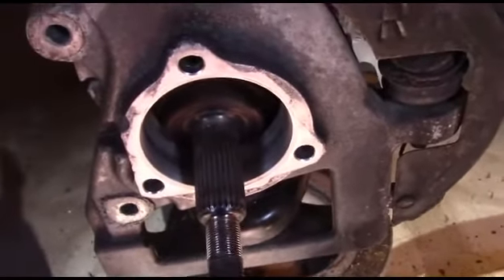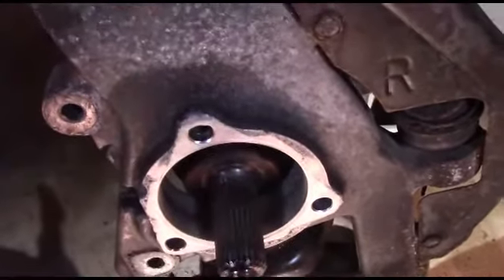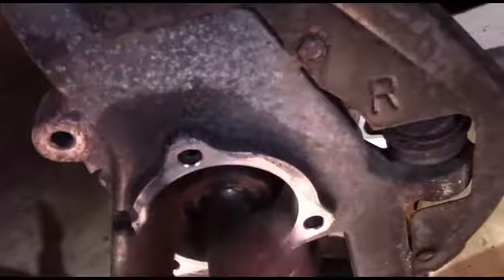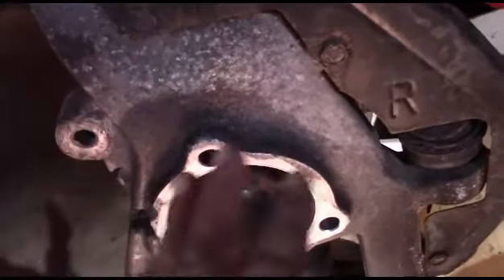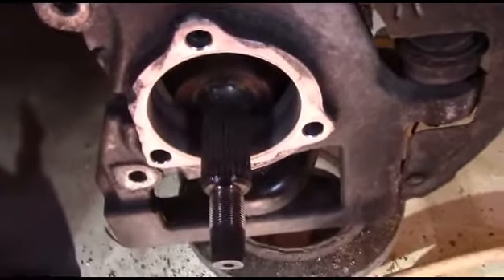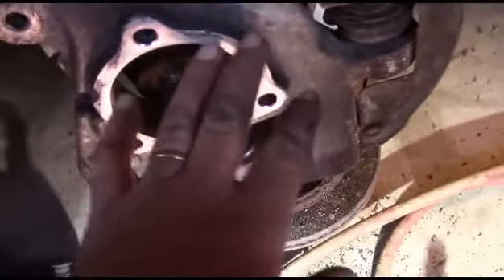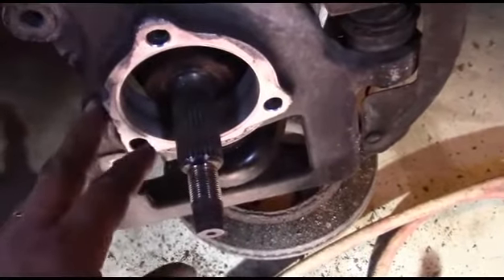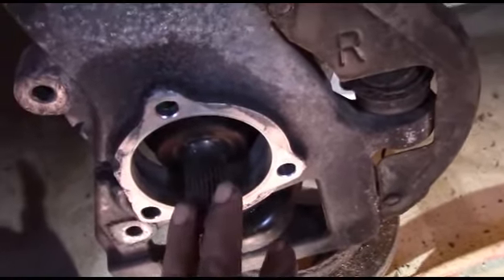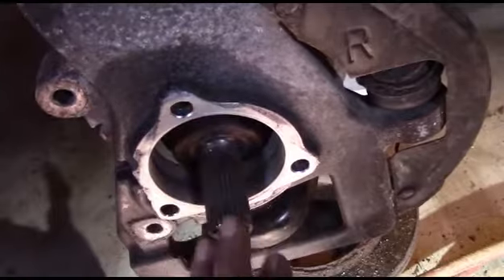The next thing I'm going to do is install my bearing. I'm going to put grease on the axle where it goes through the hub, and I'm going to put anti-seize compound in this bore where the bearing goes in. I'm going to hope that the bolts draw it up all nice and even, even though that corrosion does seem to stand a little proud. There did seem to be some factory sealant — like silicone sealant — but it didn't do a very good job because there's plenty of corrosion in there, so I'm not going to worry about that. I watched another video where a Ford technician does it and he didn't put any sealant on there, so I'm just going to put her together and we'll see how things go.